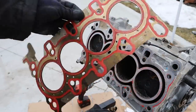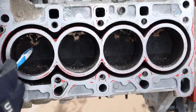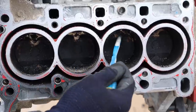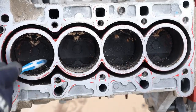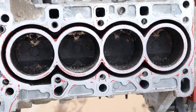I have to say I'm quite disappointed in the combustion chamber — there's quite a lot of carbon deposits built up on top of this piston head. I thought it would be practically clean with only 2,000 kilometers on it, but it does have a lot of carbon. That's kind of amazing. I wonder if they just use cheap gas, or if that's just the design of this engine's combustion cycle.